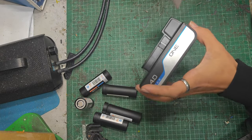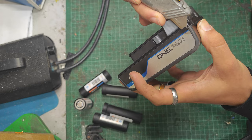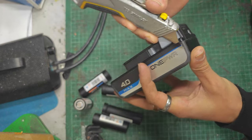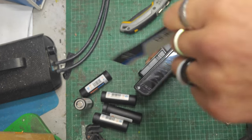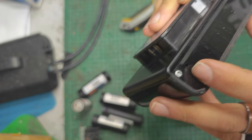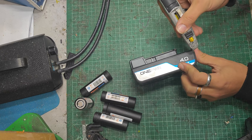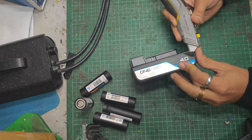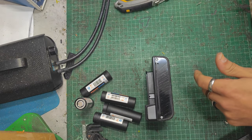To open this, we've got to look underneath these stickers. If you look underneath the stickers, you see, what's that? Teeny tiny screw hiding there. It is. I'm going to peel the stickers all the way off. I don't know if you have to or not, but they're coming off. There's one screw, two screws. These are T10H, so security Torx, I think. I'll have a look in a sec. Get this other sticker off. If I can do it without damaging it, it'd be nice. Oh, look at that. Who's done this before? I'll give you a hint. Me.